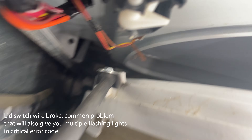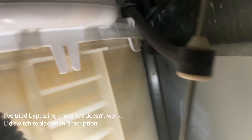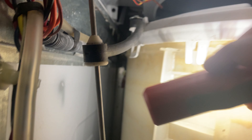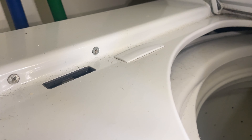Now if we look up here, there's our problem — bare wire. The lid switch, this is your lid lock, that's the lid switch mechanism. That broke. These usually break from the drum wobbling too much. Everything looks like it's still intact; sometimes these plastic pieces break causing it to go crazy when it wobbles, but other times it's just overloading it. So let's swap this out.